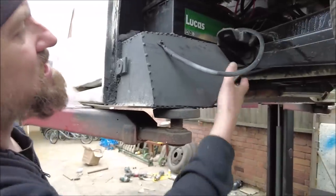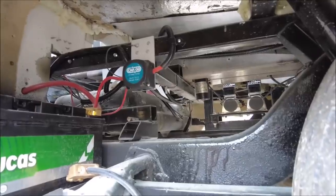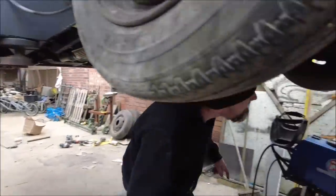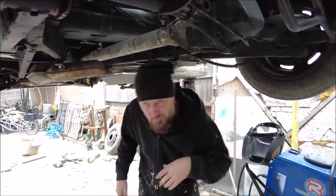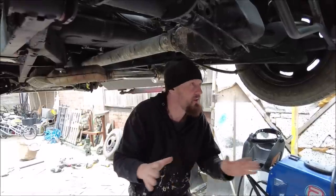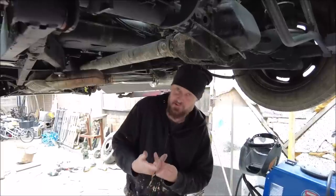All of this, of course, is the end of those big skids it's got underneath it. We've got the battery here running to a split charger because there's just so much stuff on this that moves and is sort of animated. We've also got another battery, which is just here. So the reason we've got the two batteries is obviously one starts the car, makes the car work, and then the other one is going to help with all the other bits like the bike unloader, just all of that stuff. And just so that, at the end of a weekend at a show, you don't try to start the car and it won't start because you've blazed the battery on just messing with all the cool stuff.